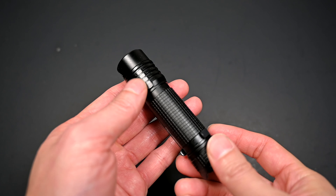In illumination mode, a quick tap of the switch will access the last memorized mode, and you simply cycle through all outputs from a low moonlight level of half a lumen all the way up to 800 lumens in turbo mode. It features memory mode — leaving it at the second level, shutting it off and turning it back on confirms the mode is memorized. It also allows direct access to moonlight mode: with the light off, simply press and hold for easy access to moonlight mode for nighttime use without destroying your night vision.